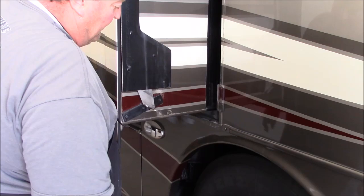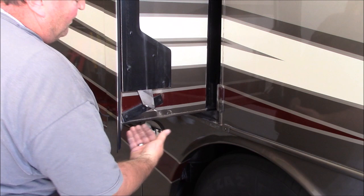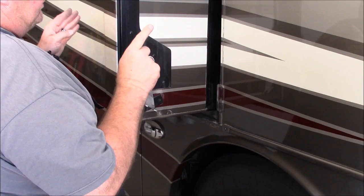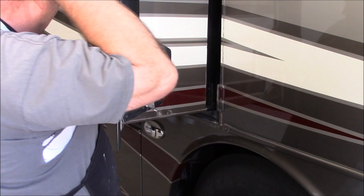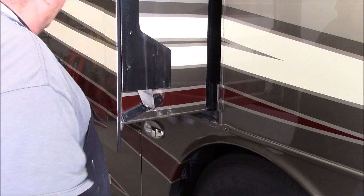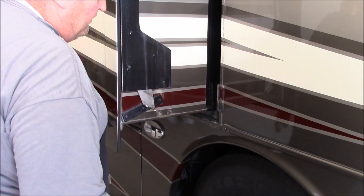When I put the roller plates, I mark on the outside, underneath the wall, where the roller is. Then I'll lift up just a little bit with a porta power to get that up away from the roller, and put the roller plate up in so that the rivets are outside of the path of the roller. And then I'll mark it, clean everything with acetone, glue up, put the 5200 on the roller plate, assemble it, rivet it into place and move on to the next one. So I have four roller plates to put underneath this slide, as well as the two RF300 corner pieces.